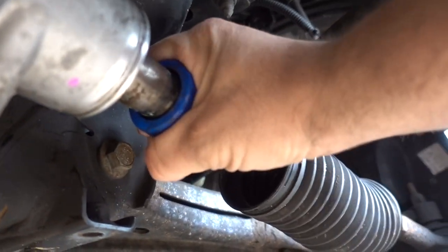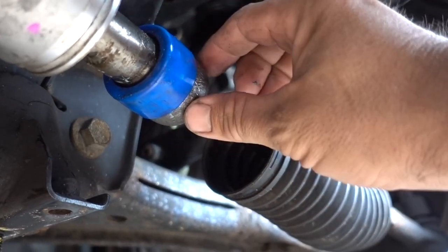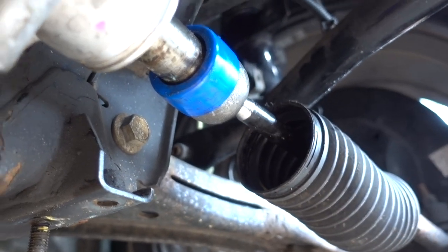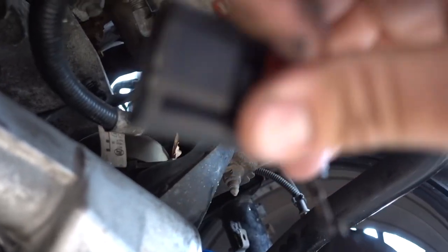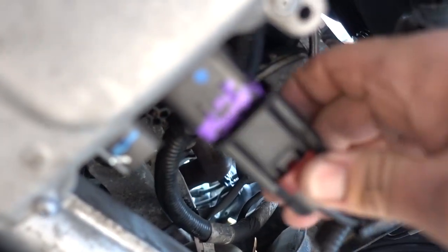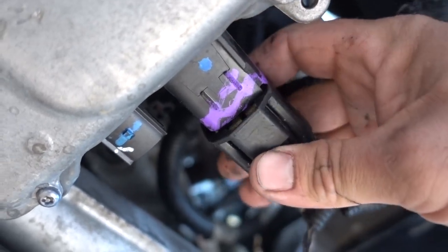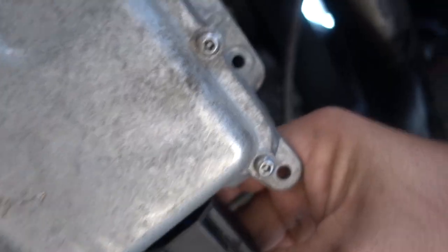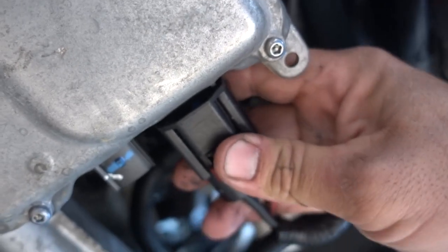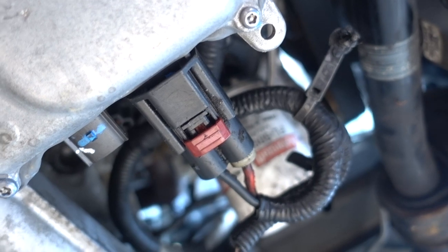For the tie rods, there's a plastic cover with a little bit of an edge that you can take a wrench to. I wound up just using a pipe wrench to get them off. You can get these off pretty easy and then the wheels just kind of sag. For your harness, you want to make sure that you take the clip off so you don't break the electrical connector right here, like the place that I got this from did — they wound up breaking the electrical connector. So now this doesn't clip on very well. We're just going to throw it on there, and we're also going to throw a bunch of electrical tape on here to get it to secure itself in place.